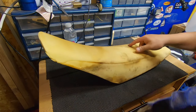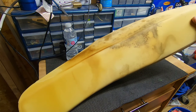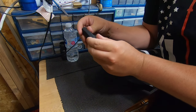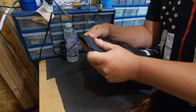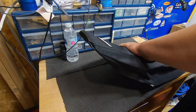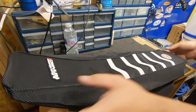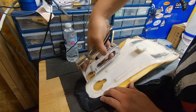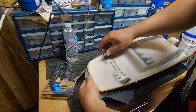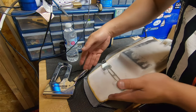Alright, that's the old cover off. I don't know if that's mold or what — kind of gross. First, you're going to want to install it on the front, get it stretched over a little bit. Make sure your seat cover is warm — if you're doing this in wintertime, do it in the house — because you want it to be pliable and stretchy. I've got it over the front, which has a little lip. The back doesn't have anything; it's made so you pull it tight, stretch it over, and staple it. I'm going to hit it with two staples.